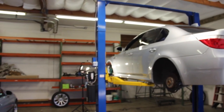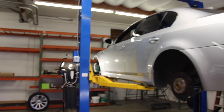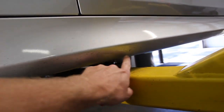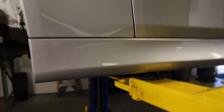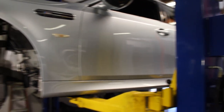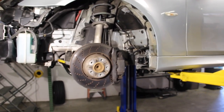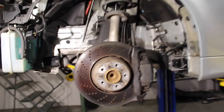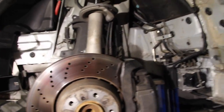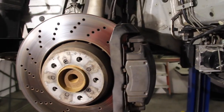We're going to start today on the front axle. Go ahead and use your front jack point, which is a little block under here. Lift that up and then use your side jack points - you've got the little triangle on the rocker to show you right where they are - to put the car safely on stands, making sure that it's in park, first gear, parking brake enabled. Before you get too far off the ground, go ahead and break your 17mm lugs free with a socket and breaker bar on both front wheels. Once the car is safely suspended, go ahead and pull the wheels off.